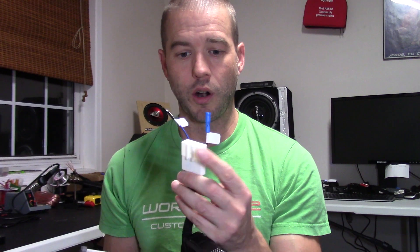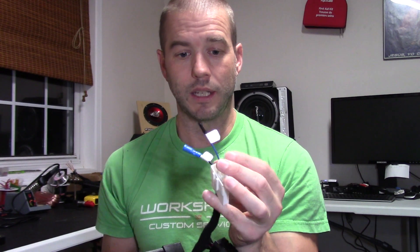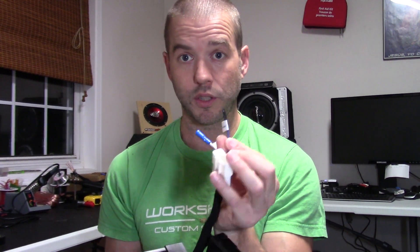All the components are the same as what were in the Mark 1.5. We have our standard OEM plug depending on the vehicle — whether that's a 370Z, 350Z, FRS, or WRX — that plugs in and gives you audio and power from the unit. We also have an amplifier lead for a remote turn-on switch if you're running a secondary amplifier for subwoofers, and we provide an extra grounding cable to run directly to a good chassis ground.